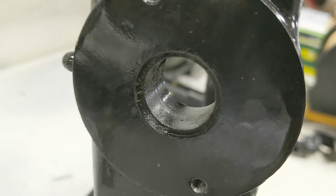This is a new swivel pin. Mine had a bunch of grooves worn into this round part right here — it rides on this surface and this surface, so both of those need to be true. Then obviously the square part has to still be square. This is a new shift cable and sheath.